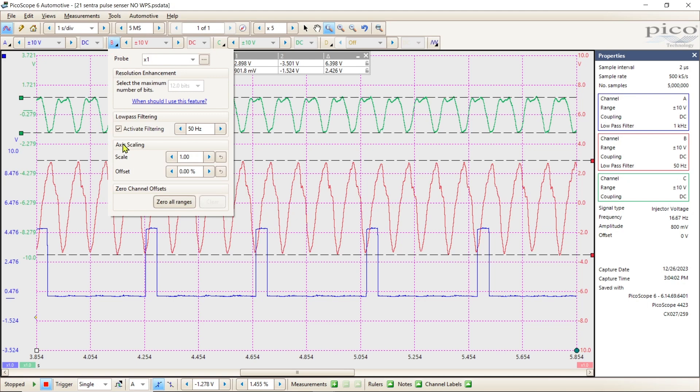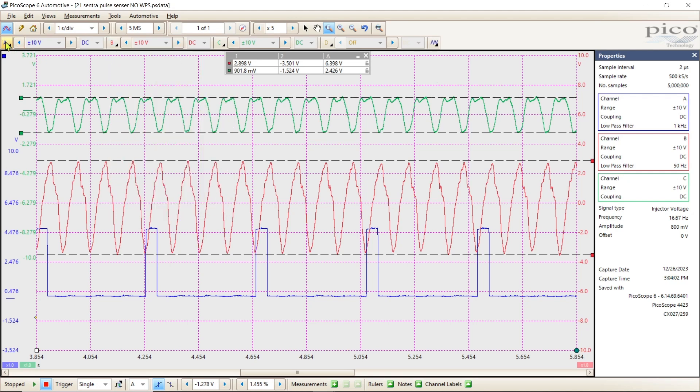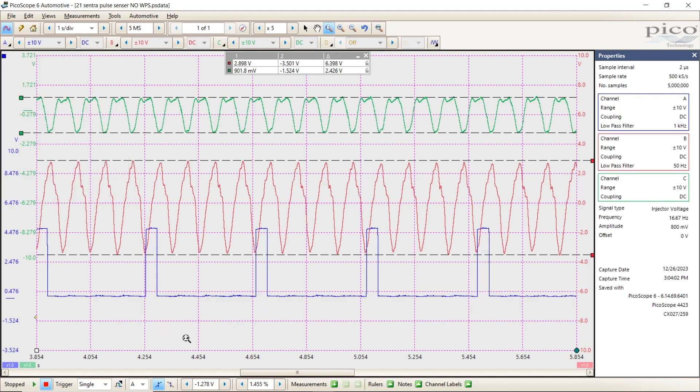If I take the filter off, that's my homemade pulse sensor — it's a little dirty, but I've got about six bucks in making this thing, so it does require a little filter. The store-bought one up here has no filter on it; it's really smooth. And if I turn the filter off the sync pulse, you can really tell the engine was cranking — you get a lot of noise. I'm going to show you the next setup and we'll go over the next capture, then flip back and forth to show you this no-no.